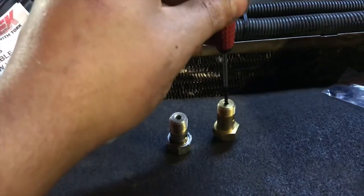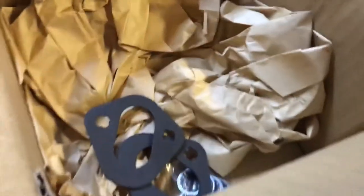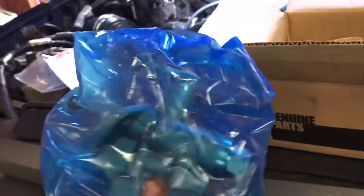I pressed the old one and it was pretty light. This new one has some force to it, so I'm feeling good about this being the issue. I've also got a new OE Cummins lift pump — I've been meaning to upgrade from the O'Reilly's one, which served me well, but if the Torque-Tech doesn't solve it I've got this as backup. Why replace a part if it's working? But let's get that Torque-Tech in and hopefully this is the cause of all the problems — I'm really sick of driving the Blazer.